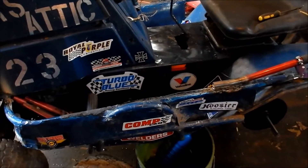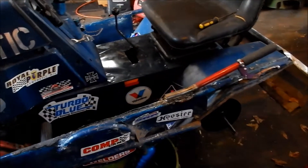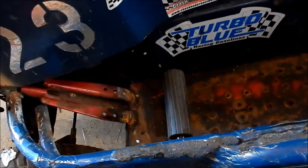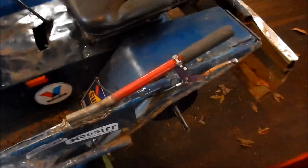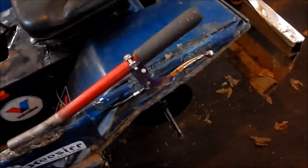I'm going to show you how to put a brake system on a racing lawnmower. I've made a couple changes — I put in the piece that lowers the mower deck and welded it right to the frame, so in case I hit somebody my foot doesn't slip through and break my ankle. I took the rest of the handle and welded it onto my nerf bars so when I'm leaning I can hit my brake system quickly.